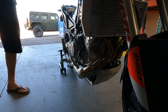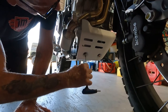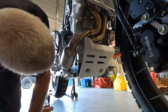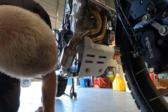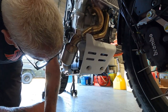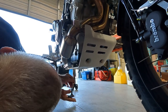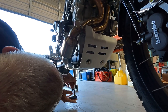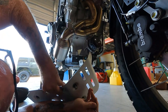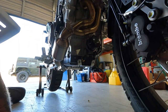Now remove the actual skid plate — it's easy enough. There are four screws on the bottom, two up here, and two in the back. You do not need to remove the nuts down there; they're holding bumpers that sit against the motor to absorb shock. On my bike these are 4mm — I changed from the OEM bolts, but stock I think they were M8s. All we're really trying to do here is create more room to work.